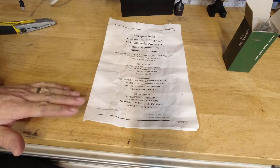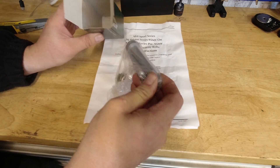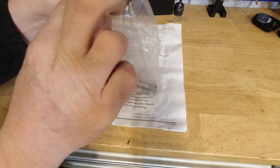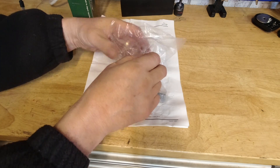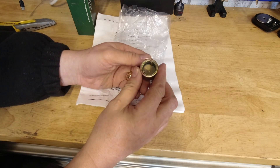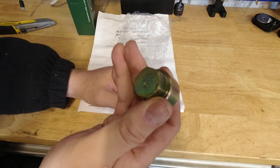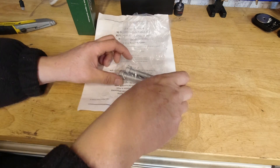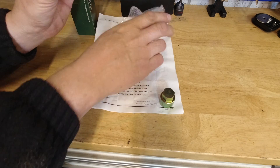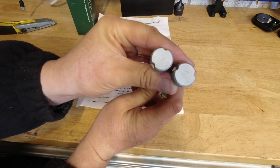The rest of it is just translations in other languages. It is interesting to note that it was printed in July 1997, so this was planned up front when this car was launched. Here's the actual kit — still sealed, heat-sealed in a bag, never been out. We've got a puzzle nut adapter, exactly the same style as those used on our wheel nuts: two dowels welded to the inside of a cylinder with a little metal strip to cover and protect them, and the bolt heads have cutouts in the edge to accept those dowels.